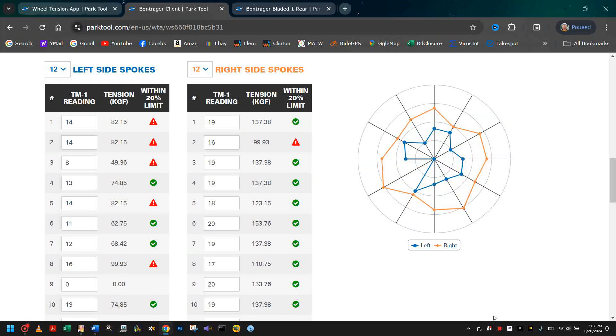This completely non-uniform radar chart indicates a serious variability, which can lead to spoke breakage or even wheel collapse — a real danger. Yet the wheel is true on a truing stand. A tension chart is a good analytical tool for making a diagnosis on a wheel.